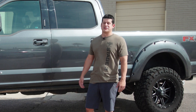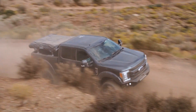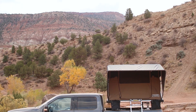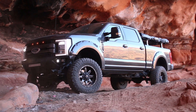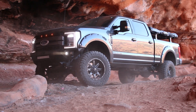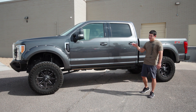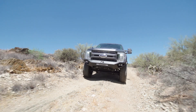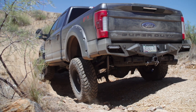I've towed a boat, toy hauler, and tractor — it tows just fine, very similar to stock. When we had the rooftop tent and rack on for our Utah trip, we had the AirLift system installed, so the truck sat a little higher in the rear. Since taking that out it sits more level and rides a lot better. I do sacrifice when I put the toy hauler on — it sags the back down, which is the one time I wish I had those airbags, but it's not worth losing the daily ride quality and overall off-road ability of the rear suspension.